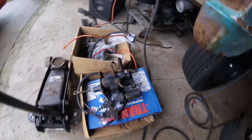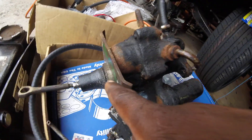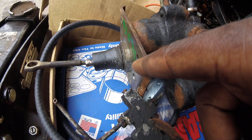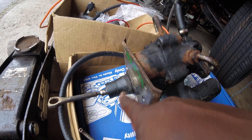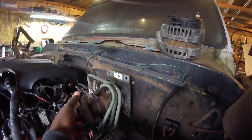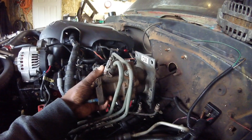So we took off the old regular manual brake booster, and the problem with this one is — you see how this plate is flat? The plate is flat, and then you have this retaining nut on the back of the actual master booster. That retaining nut holds the booster to the plate, and then the plate bolts to the firewall. But the hole where the booster goes through the firewall is actually smaller than this nut, so you would have to dremel the hole out — enlarge it. The hole is already about 1.8 inches and it needs to go out to like 2.1.